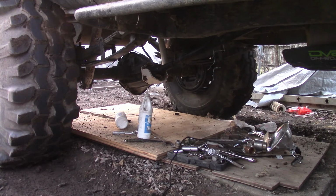The brakes aren't holding it good enough to try and really power brake it some to actually get the tires spinning. They've got that wheel seal, the wheel cylinder back there bad, so I'm sure them drums are wet, and then the brakes need bled off from where a line was replaced. But she's digging on both sides.